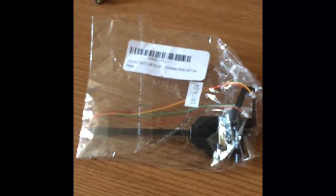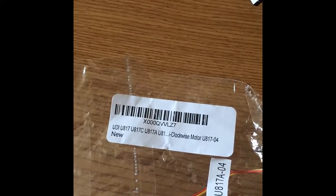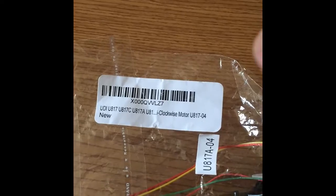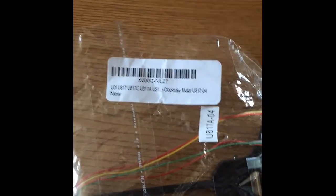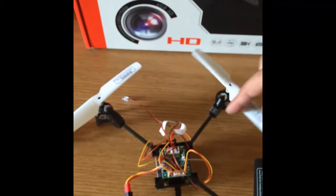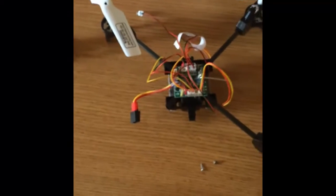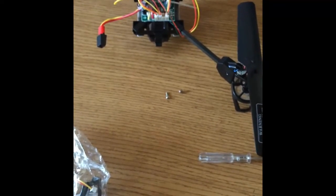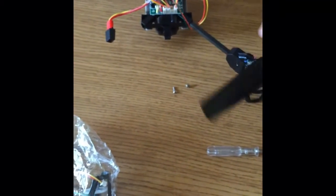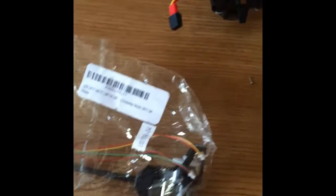Now here we have the brand new one. One more thing: you want to make sure that you get the right motor. In this case, mine happened to be a clockwise motor, and you'll be able to tell just by your particular drone. They tend to spin against each other. Looking at these two white propellers — this one spins counterclockwise, so this one right here spins clockwise. Then over here, this black one spins clockwise, so the one across from it has to spin counterclockwise. Just pay attention to that when you're buying it, otherwise your drone won't fly right.